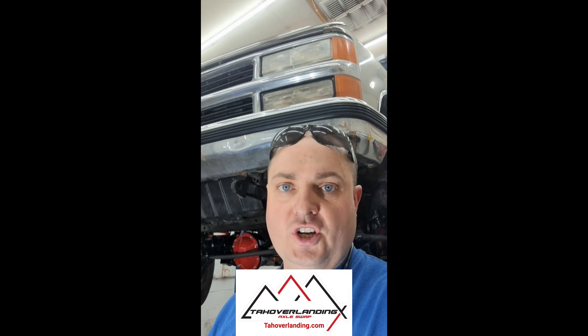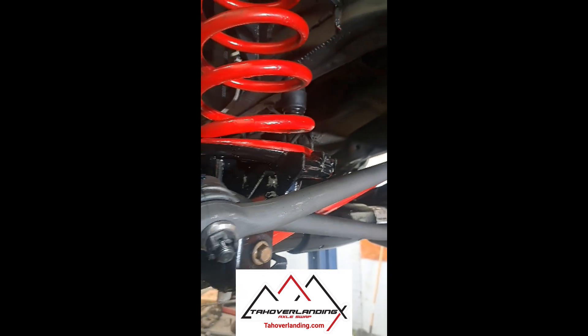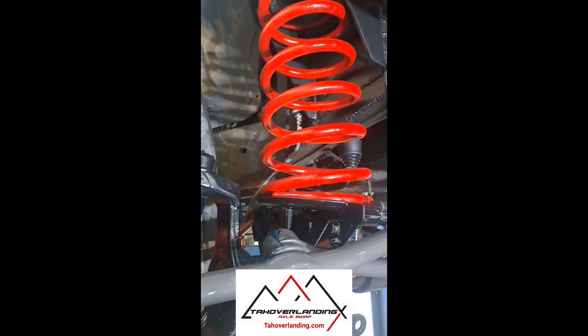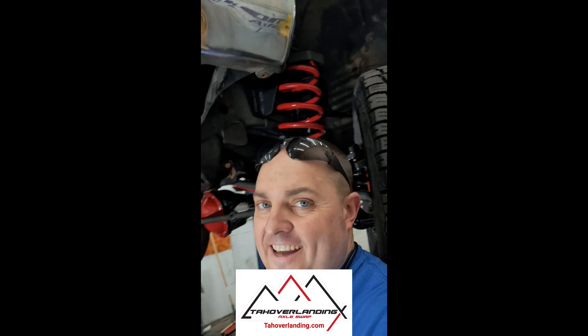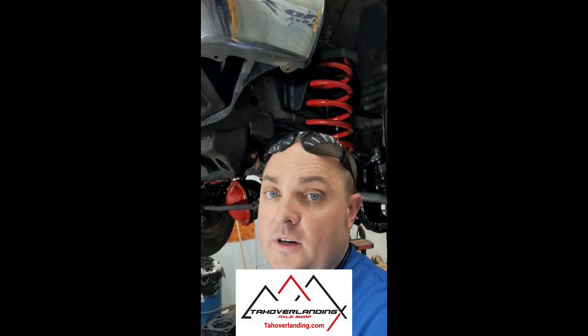Can you use T-style steering on your truck? Let me show you why we supply the Y steering. The T-steering is unnecessary — all of the things it solves on a Dodge truck are not present on a Chevy. It's a different truck, different arm geometry, different steering geometry. And there's a reason we don't provide it: the steering box on the Chevy is in a different relationship to the axle than on a Dodge. This right here is the Y-style, and look — that's like a quarter of an inch clearance. If we had the T-style going up across, look what it gets into. That's also why we run that size of steering link — it's a tight package.